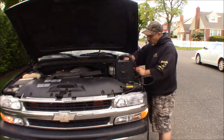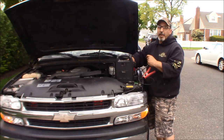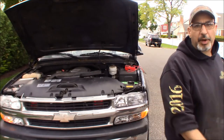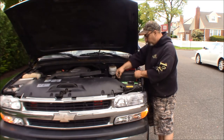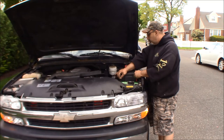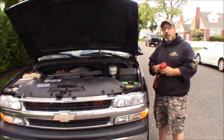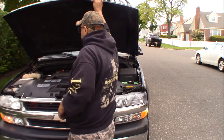It's starting. Going to the battery. And I guess we're just gonna have to wait and see whether this battery is gonna take a charge or we're gonna get 2 batteries this week, because we do have another vehicle with batteries. I'm at a steady 1430. Belt looks good. Alternator's not making any funny noises. Gauge in the vehicle's good. Everything is as it's supposed to be. I'm just gonna let it idle for a little while and see what happens.